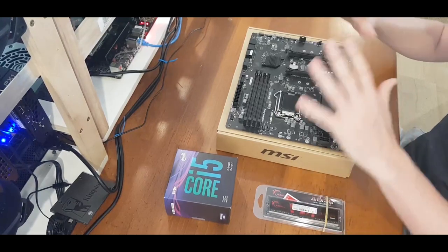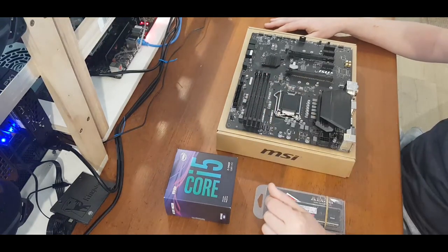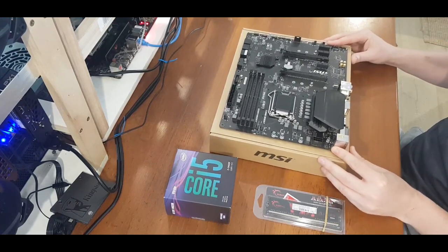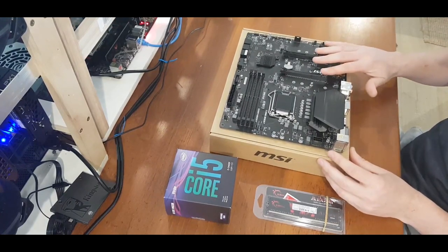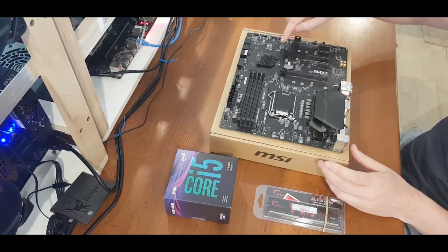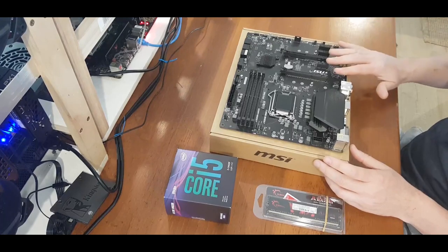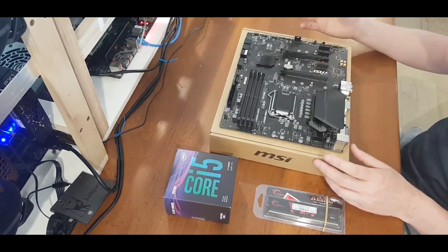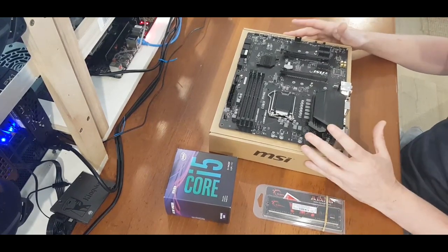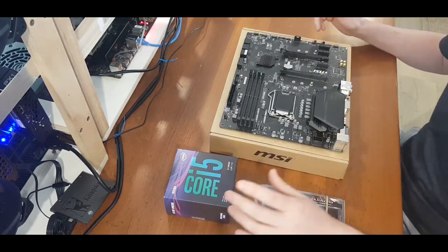So here is the motherboard, this is the MSI Z390 PLUS. It's an OEM motherboard, so there are no fancy boxes. But what I like about this motherboard is it's got five slots plus two M2 slots you can convert. But I have found if you convert this second slot, it does knock off this PCIe slot. So what I normally do is I'll do five plus this one here. At present, I've loaded up to, I think, 10 cards on this type of motherboard on another rig. I think you can get up to definitely 11, and 12 is a question mark. So that's something we'll try later.